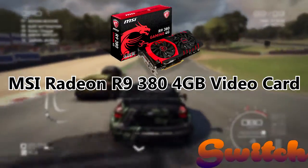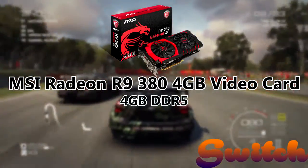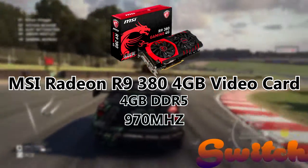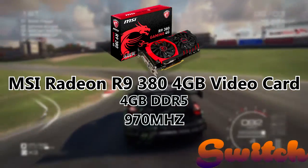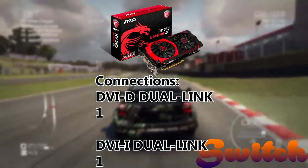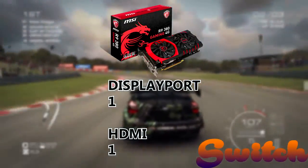For the video card, we're going with an MSI Radeon R9 380 4GB video card. It's rocking 4GB of GDDR5 and comes at a core clock of 970 MHz. It tops out at about 190 watts. It comes with Crossfire support and FreeSync support as well. It comes with DVI-D dual link connections, a DisplayPort and an HDMI port.